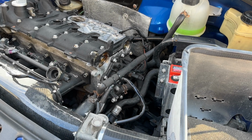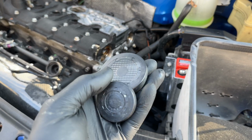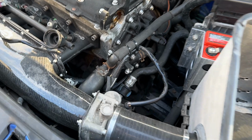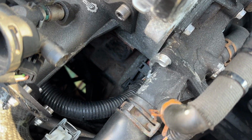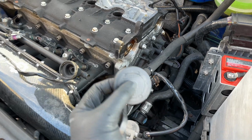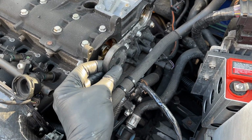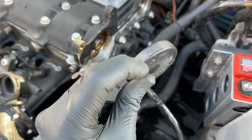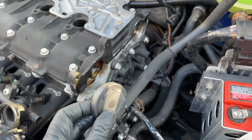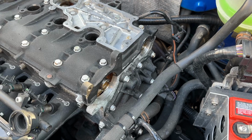With the crank pin removed and the horseshoe, you now need to fit the new blanking caps, as we put a screwdriver through the old one and put back in the original E-bolt in the bottom there, the E-Torx one. As I say, we'll do that now, and just be careful when you tap these in, because you don't want to go too far. Normally I like them just to the last ridge there and all squared up. I don't like them in wonky or at an angle. It's the little touches that finish the job off nicely.